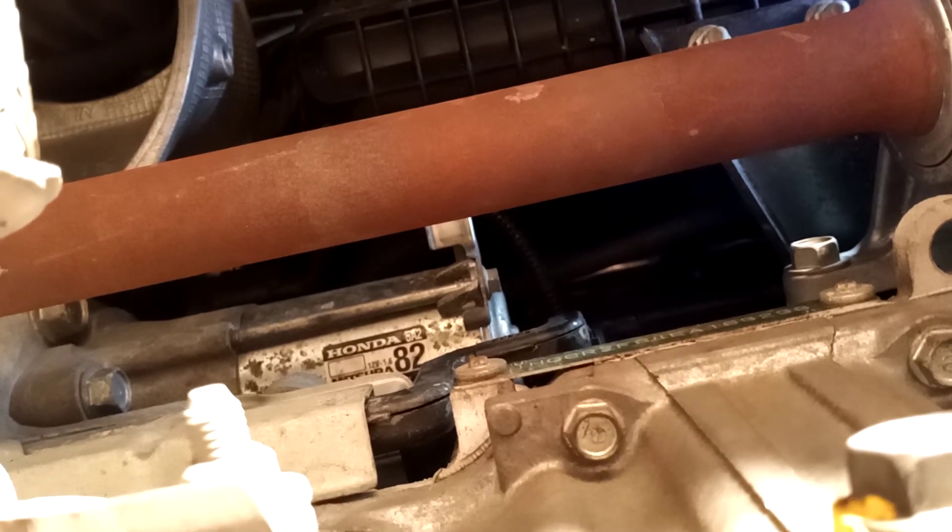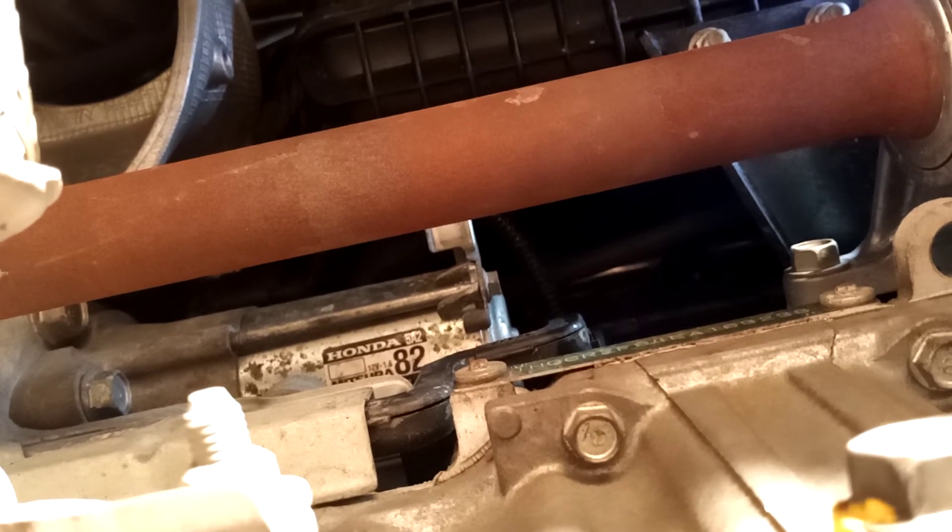At this point I know you had a good chance to hear that click. When I did get it running, I was able to test the battery and the alternator - those are starting and charging just fine. The battery standalone, as you saw, is just fine. So now I'm going to go ahead and work on removing this starter.